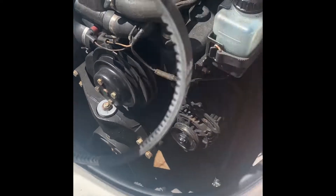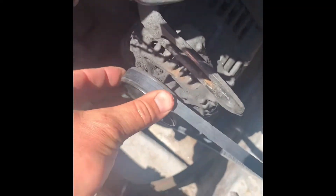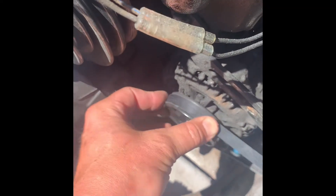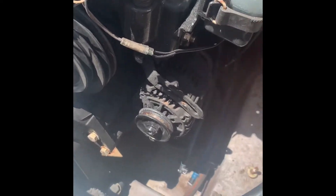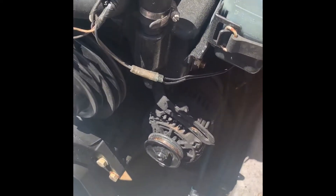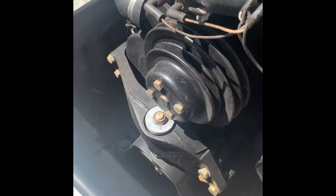I don't see it being a problem at all fitting in the grooves — we'll get plenty in the groove. That belt will definitely work as long as my length is good. I've been seeing some people complaining about wanting to remove the entire engine bracket. Not necessary. It looks like there is a secondary removable piece here, so it should just be these two bolts to access it.